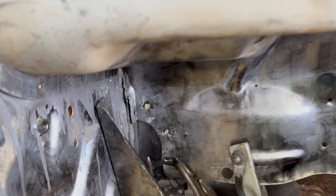So the next step for this engine bay is going to be paint. I do need to apply some seam sealer along all these seams here along the front, same with this side over here, and then I have some more work to do on the firewall to get that ready. So I'll be showing how to prep and paint this engine bay in the next video. Thanks for watching.